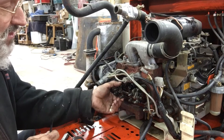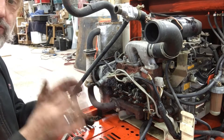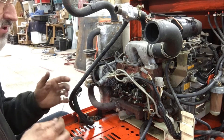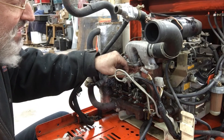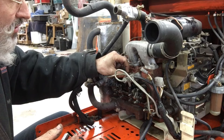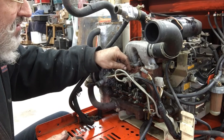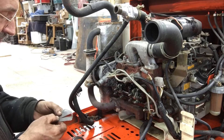The specs on the valves — in this case, six thousandths of an inch on this one — but do check your manual to make sure you're using your specs, not mine. The spec is five to seven thousandths, so I'm going with six.